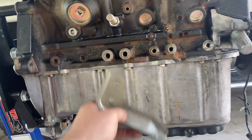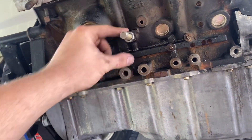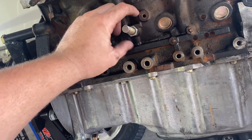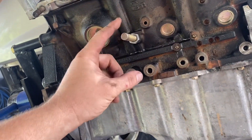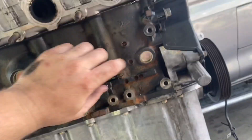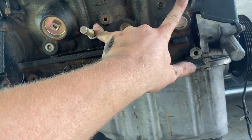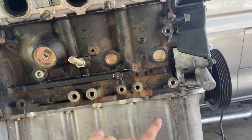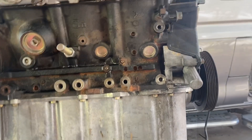This is the mount off the 380 block — we're going to toss that. There's a blank threaded hole here, so just match the bolt up. I think it was like a 17mm bolt, and I've just made a stud by cutting the head off the bolt, then used a nut to space it out so it'll sit flush. We're going to have a bit of strap across there, and then the original mount off the 6G72 will bolt up.